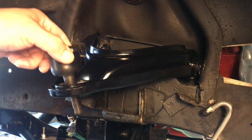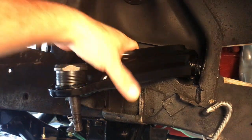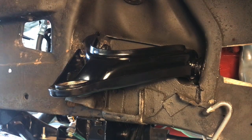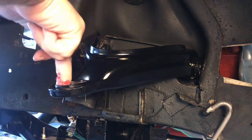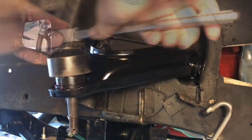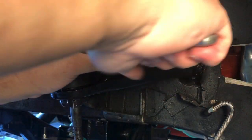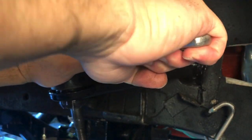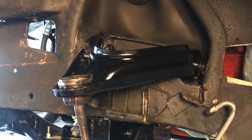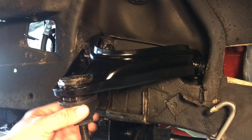Alright, as promised I'm gonna put the upper ball joint in. I'm gonna use the car as my anchor, my vise. Before I do that, I'm gonna throw some grease in the threads. That was almost too easy, so we'll get the boot up in here.